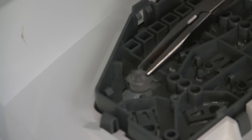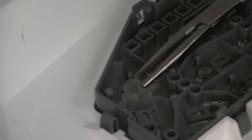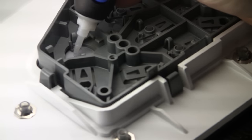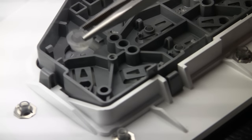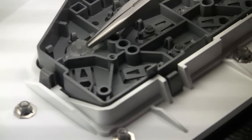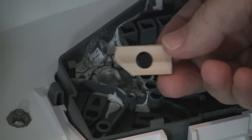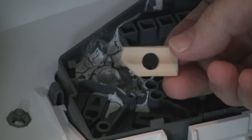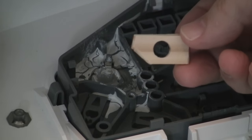My thought for fixing this issue was to simply take the plastic button and superglue it directly to the inside of the start button cover. When I press the start button on the control panel, it would cause the plastic button to move in and press the button on the circuit board. It turns out the button on the circuit board does not line up with the plastic button — it's offset. So I used a small piece of a paint stirrer stick, drilled a hole into it to fit over the button, and cut a notch into it to fit into the space.